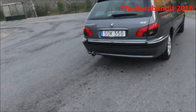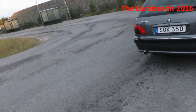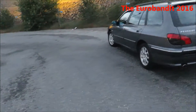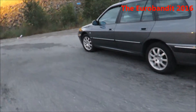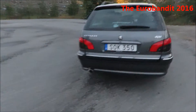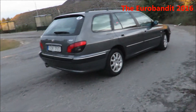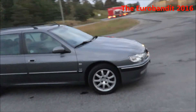I bought a laptop from the XP era and did a fresh installation of Windows XP, and I bought the PP2000 for the Peugeot and the Lexia 3 for the Citroën. The Lexia 3 came with one installation CD, sockets for both OBD1 and OBD2, and a lot of good stuff, but unfortunately I couldn't get it running. When I took it for diagnostics last year after purchasing it, they couldn't read the codes either — but the shop told me they replaced a fuse and then it could read the fault codes. I assume it has the exact same fuse issue, so I'll have to look into why that fuse keeps blowing.